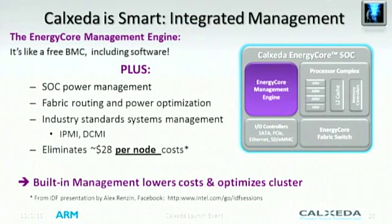So let's talk about it being smart. By smart, it means we're building in intelligence — and intelligence means you've got to have a processor. This processor has a dedicated real-time operating system running on the fifth processor, doing your basic baseboard management control functionality: turn the processor on, turn it off, boot from a specific image, boot remote, boot local. Then we take it a step farther — it optimizes the power consumption of the processor. There are 12 different power zones on this chip, and it optimizes them to reduce power even further than the 5 watts Barry mentioned.